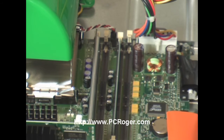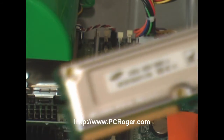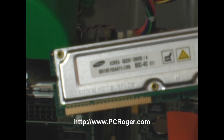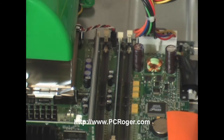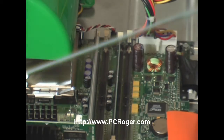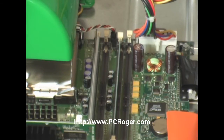Here you can see I've taken out one of the pieces of memory and one of the continuity boards from each of the banks. And again, carefully in front of the camera — you can see that this also is the 800-40 that was in there, and that's what I'm trying to match. This is what that continuity circuit board looks like — there are no memory chips on it, but it does have to be in the machine if the memory banks are not filled.